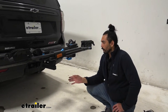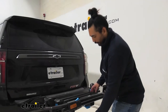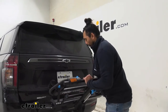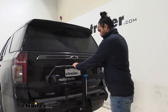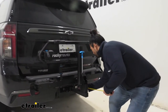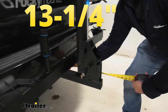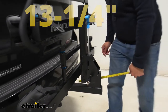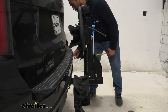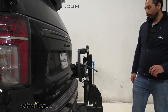Something to keep in mind for shorter vehicles: when you go up hills, your back does drop. To tilt up, we're just going to grab that same lever and go up this time until you hear that click. And now the distance from the bumper to the furthest point out is about 13 and a quarter inches, which gives you a lot more room.